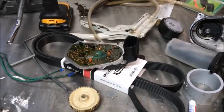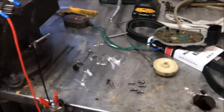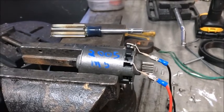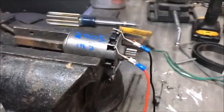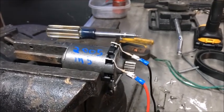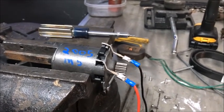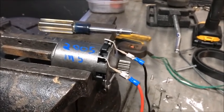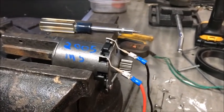I can't figure out why mine faulted again. I got the old motor out of mine and I'll put it in in a minute. The one that I know was bad — the eBay seller said it was bad — it was out of a 2005 M5, so I think it was one of the original ones. I hooked it up to 12 volts. I'm thinking this is probably why in a lot of cases when we rebuild these and put new gears in — if we don't check the little motor, the motor may be the reason it's overloading or full of carbon. I'll show you the carbon dust in a second.